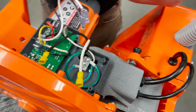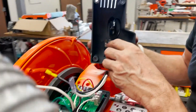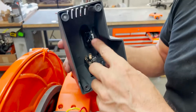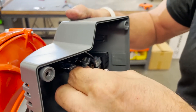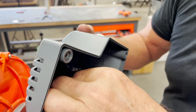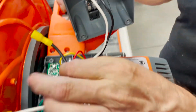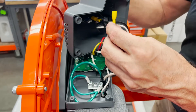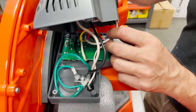So when wiring it up, it would be facing this way — the cover would drop down. You have the center terminals; the center terminals are your output. So you have the black wire coming from the overload — put the black wire directly above that. And then the white wire right next to it. The black wire from the power cord will go into the overload, and then the white wire will go right below the white wire on the switch. And there you have it — that's basically your wiring.